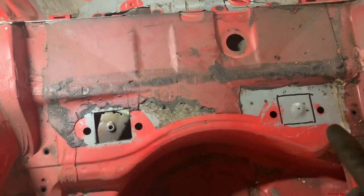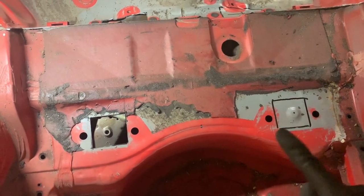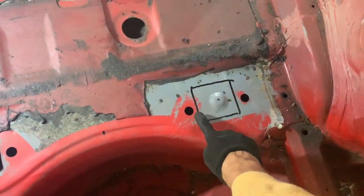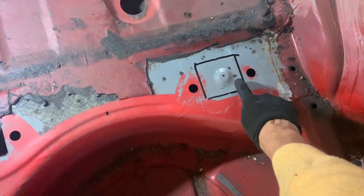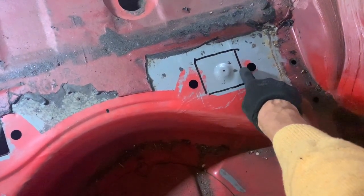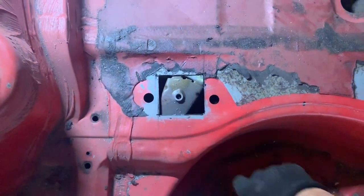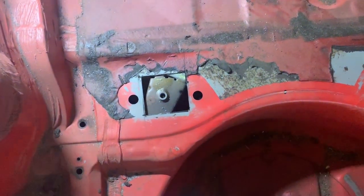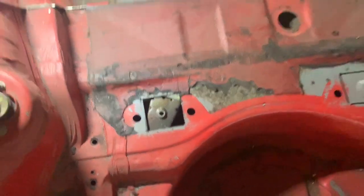This is the location where they tear out, and on the underside of the car we've marked them out on this side where we cut them — and there is the final result after cutting it out. What I always do is I go in the middle of these circles, which normally have little plastic covers in them. This isn't exactly the middle because the distance between these points is not equal. However, this point is exactly where this bushing sits. I like to have these distances the same for when you weld the plate back in, which is obviously what we're going to do. It's visually a lot nicer.